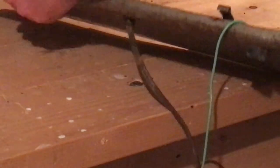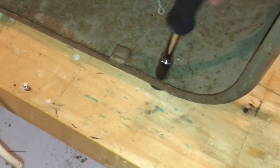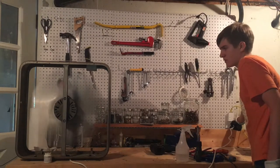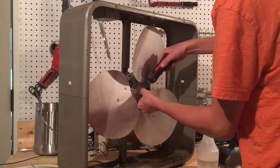Now I'm going to snip that wire and try to pull it out. Right here — more than wide enough to put our new cord through. I'll have to put some kind of epoxy around this. The primary purpose of that is so that it doesn't get cut, because people tend to yank cords. Now that we know the motor works, I'm going to remove the blades so we can do a little bit of work on the motor hopefully.